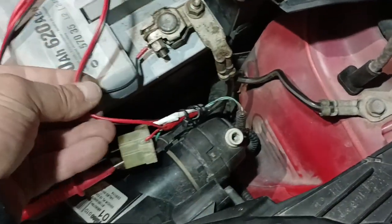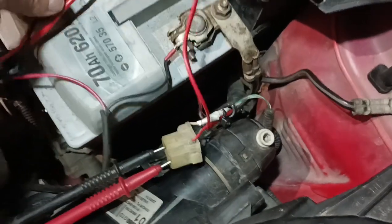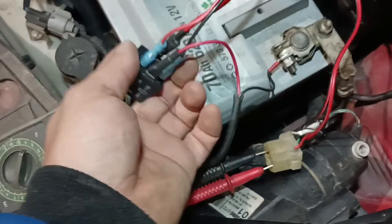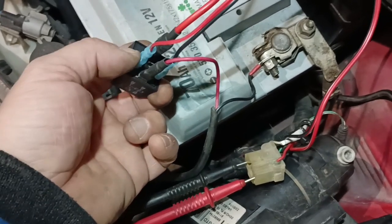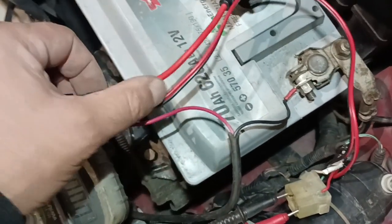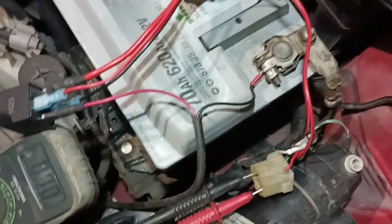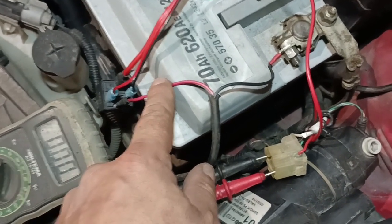After that you make jumper cables of those two, then the one you confirmed to be negative goes to relay ground, 86. The positive one goes to 85 as trigger signal. Common supply from battery, 30. Remember a fuse. And then output 87 goes to light bar.